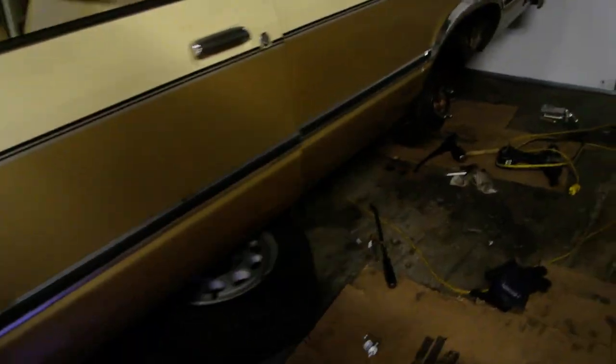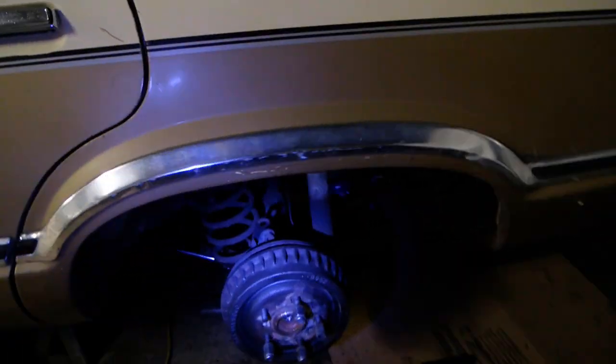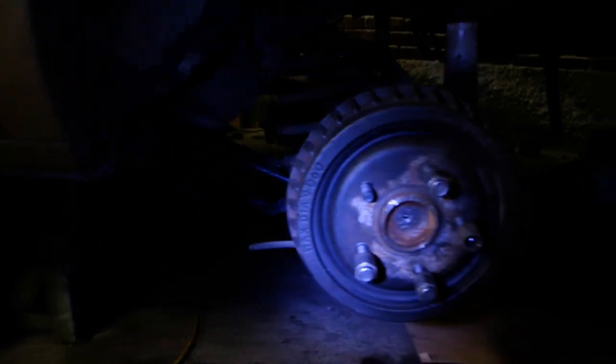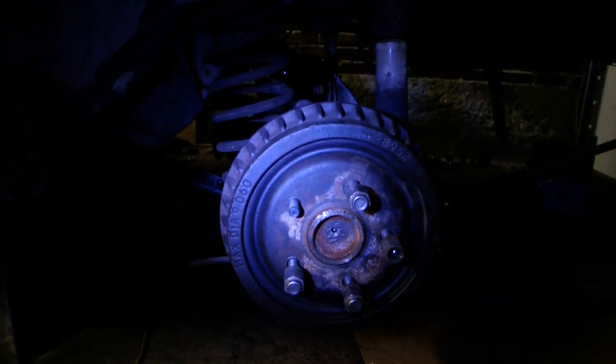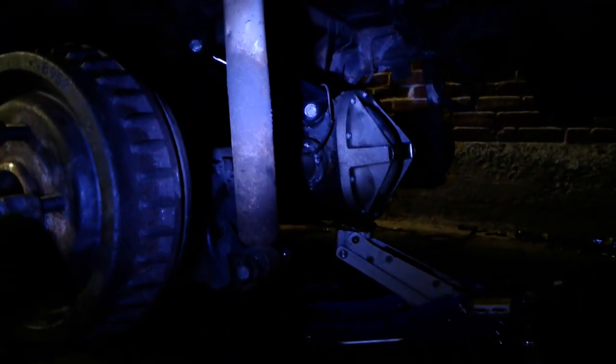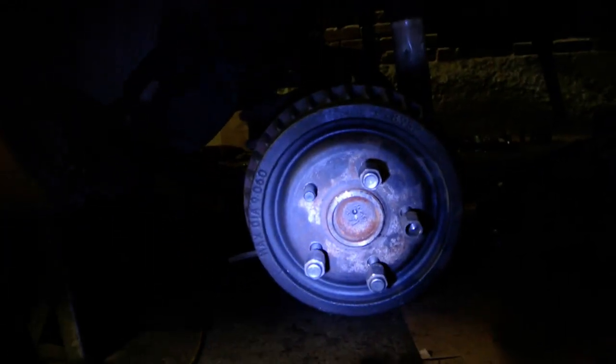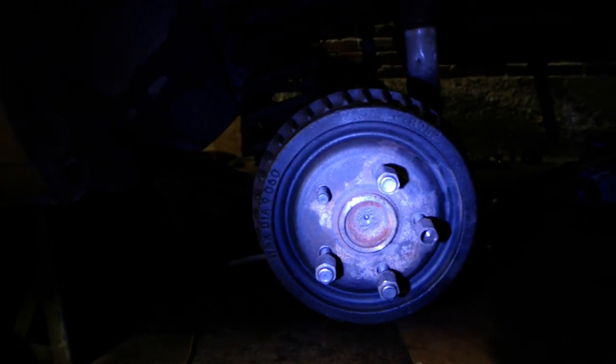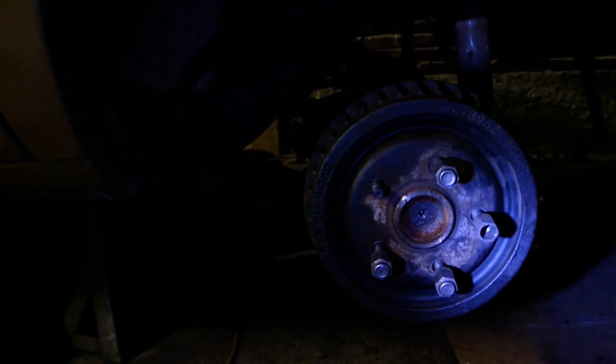So today when I got home from work, I had the 7.5 rear. Oh, it's over there. But I ended up buying a Mustang rear. This is a 5-lug, 31 spline, Moser axles, everything in this rear, so I ended up picking it up for cheap, so I put that in. And then I always buy Summit tubular upper and lower control arms with polyurethane bushings because they're a beast. So I have some 5-lug wheels, but I love 10 holes, so I might actually get 4-lug axles for this car, or re-drill or do whatever, I don't know.